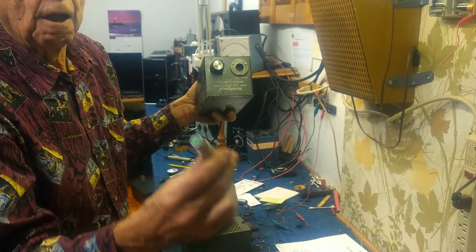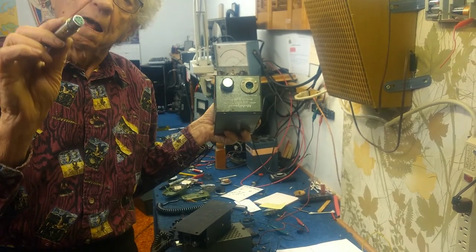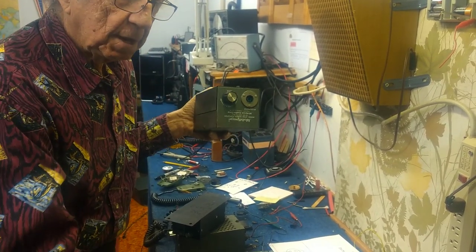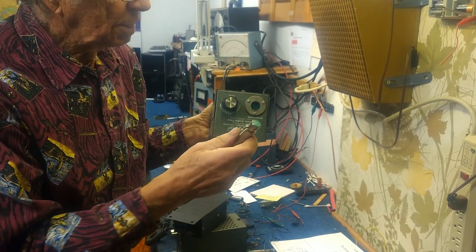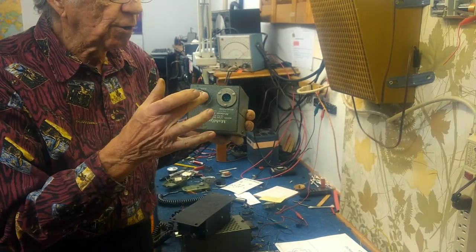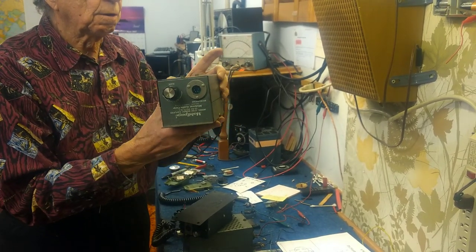Over here is where the microphone plugs in, and that is a four-pin XLR — a standard four-pin XLR. All of the PA systems in auditoriums, schools, radio stations, and all sound stages take the three-pin XLR. Those are all the stage microphones. This PA system takes a four-pin. The buses take a four-pin because when you key the microphone, you turn on the amplifier. On stages, all of the amps are already on, so the three-pin XLR works just fine for that. So this is the older style 12-volt PA system you'll find on buses.